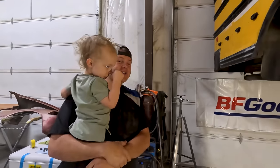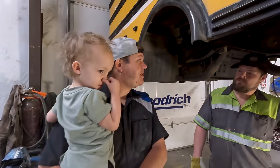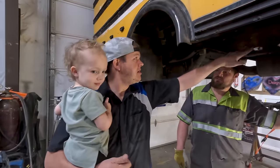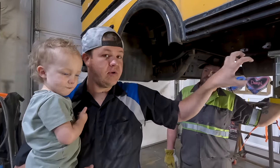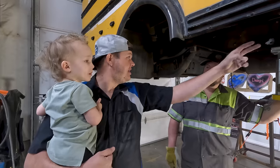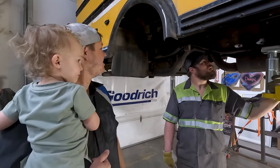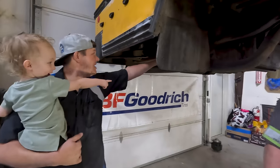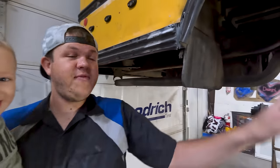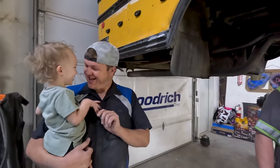All right, so Lincoln's going to be helping us out. We got a lot to do. But first things first, we're going to measure out our bolts. All we want to do is slide that front hanger the correct amount of distance forward. Hillbilly's going to start cleaning all the oil and getting the frame buffed so we can draw on it and see our drawings. We're not going to worry about the rear hangers yet because those are going to be determined off of the front spring hangers.